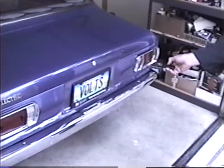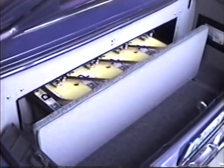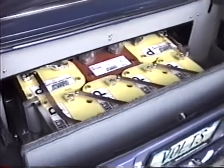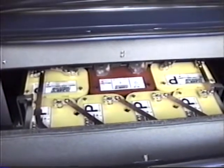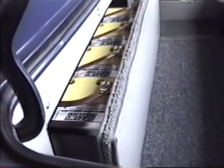Electric trunk release. People ask where the rest of the batteries are. The rest of the traction pack is hidden away right over the axle — right where the gas tank used to be. There's a red battery in there; that's for the stereo equipment. When the battery pack is retracted, you have a full usable trunk, which most other conversions don't have.